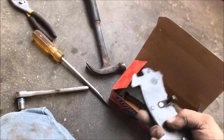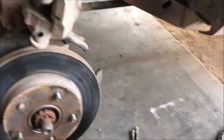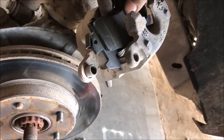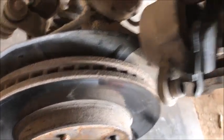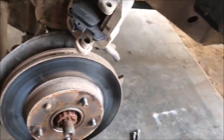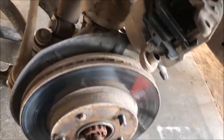You've got two types of brake pads in here: one with a clip and one with a flat plate. The flat plate goes towards you on the outside, and the one with the clip goes on the inside. Just set it right in there and snap it down. Second one goes the same direction — you want the half-moon on the outside to follow the curve of the rotor.